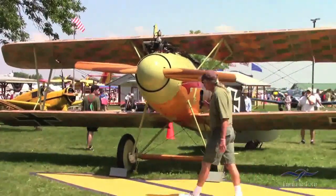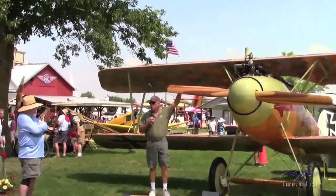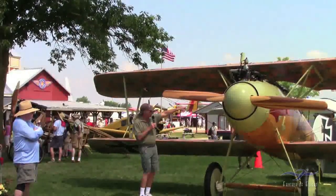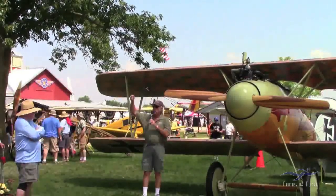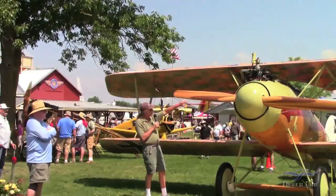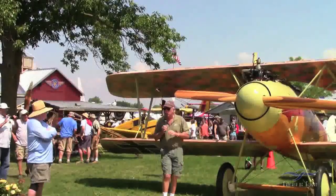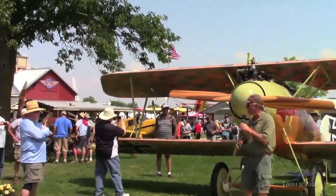Also, some other interesting things is the fact that the radiator is in the wing right here, and everybody knows that there's less pressure on the top than there is on the bottom, so that makes it efficient, so the air flows up through the radiator. There's a little handle in the back there, and if I want to adjust the radiator shutters, which I can see, all I do is stick my hand out the cockpit and move the louvers. And if you get a chance to look here as well, these are the radiator pipes that come up to go up to the radiator, and sticking out one of them there is actually the radiator temperature gauge. So the airspeed indicator, the temperature gauge, and the shutters are all outside the cockpit.